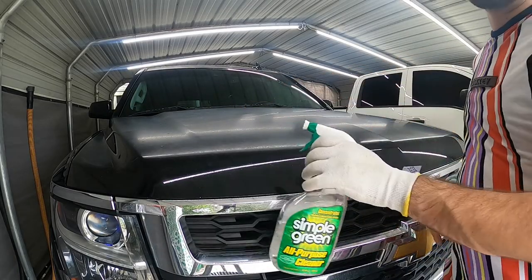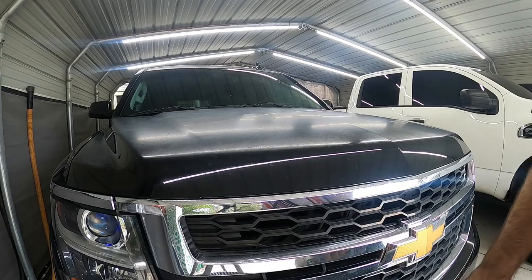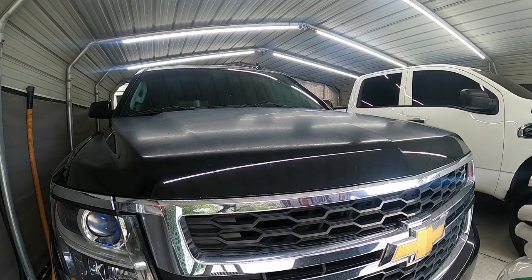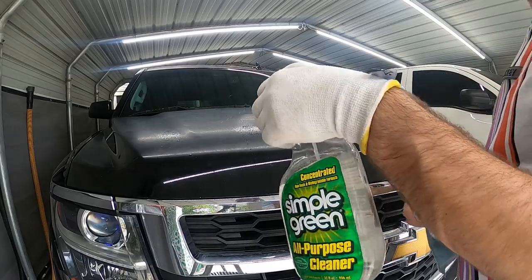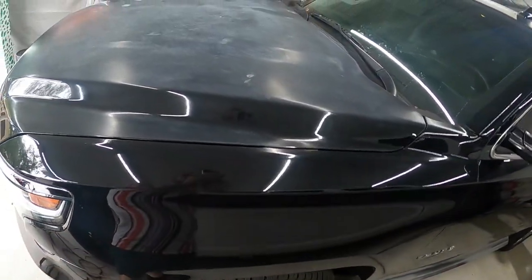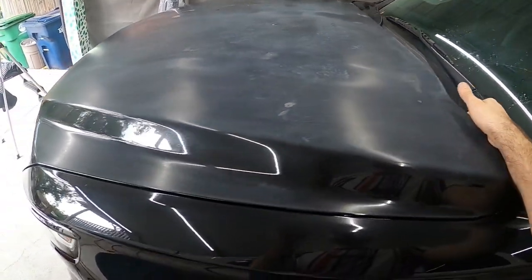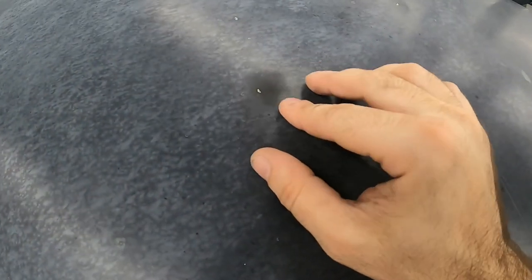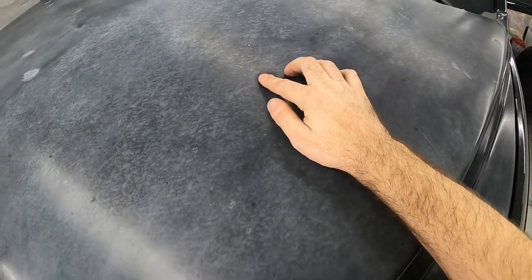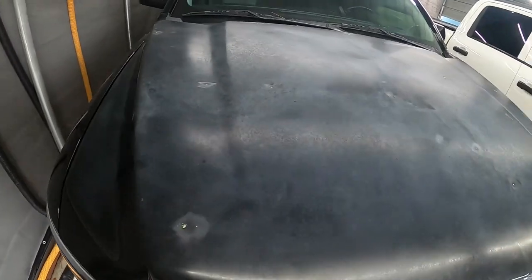First you're going to want to get the surface as clean as possible. For that we're going to use distilled water mixed with isopropyl alcohol and a microfiber towel and start surface prepping. I've already washed this vehicle. I finished the surface prep, popped the hood, cleaned under the edges really well — that's always very important. I fired up the air compressor so right before I lay the wrap I'm going to blow off any remaining dust particles. There are some rough spots where there was some chipping, so I used some fine grit sandpaper to get the main chipped areas smooth before wrapping.